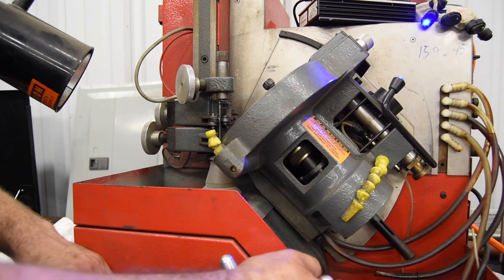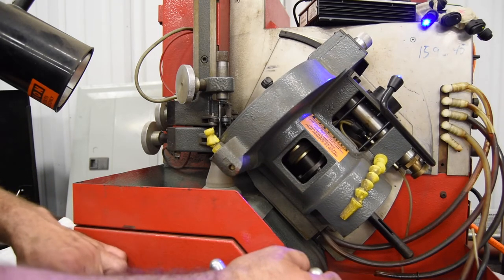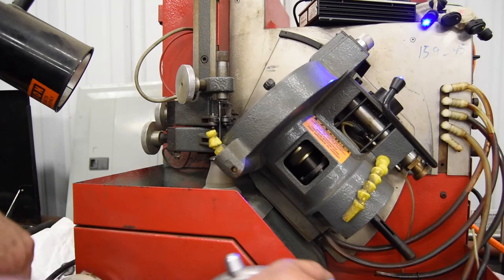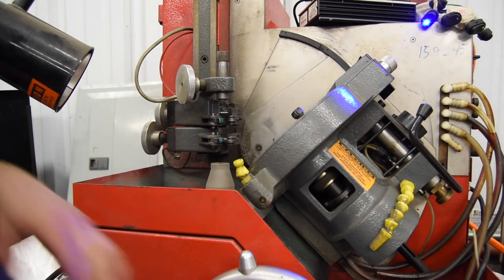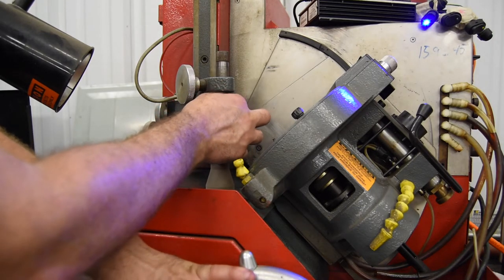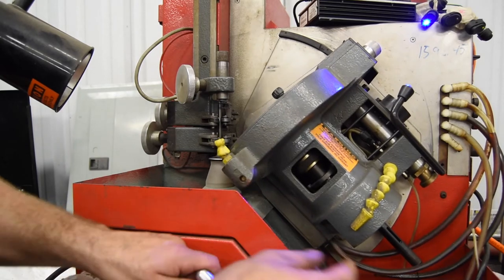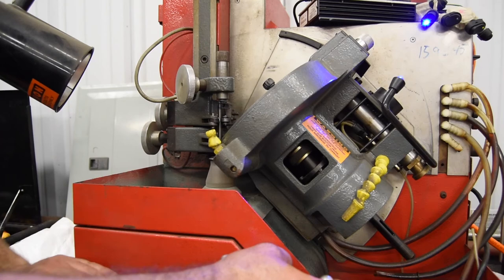Which isn't too bad, because if I understood it correctly, this cylinder had actually had a burnt exhaust valve, which meant the combustion chamber temperatures were high enough to melt an exhaust valve. And surely that was high enough to at least distort some intake valves a little bit. But I might be wrong about that. Either way.